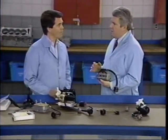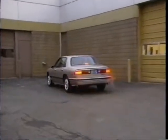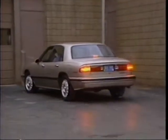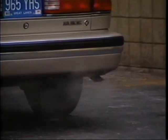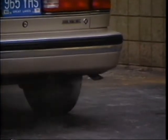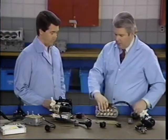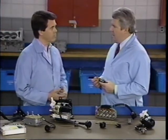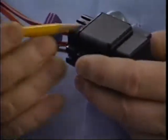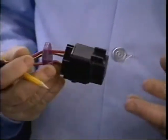So in checking for intermittent shorts inside the PMV, you should always test the car after it has had sufficient time to fully warm up to operating temperature. Let the car idle for about 20 minutes, out of the wind, and then perform your checks. Another condition that may be difficult to pinpoint is a code 45 that is caused by an intermittent fault at the ABS main relay. On newer relays, the contacts can sometimes be contaminated by small particles of plastic from the relay case.